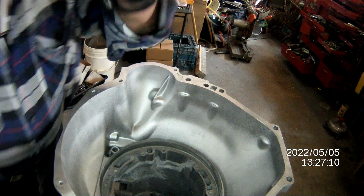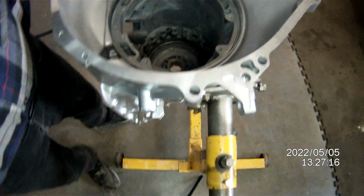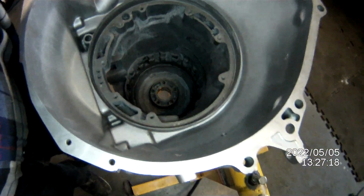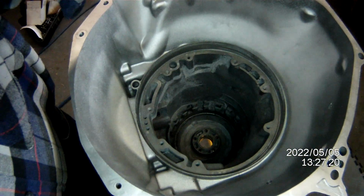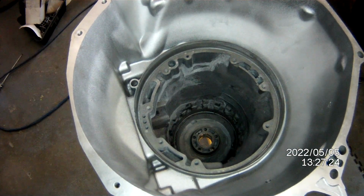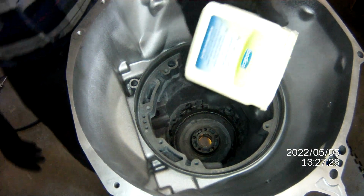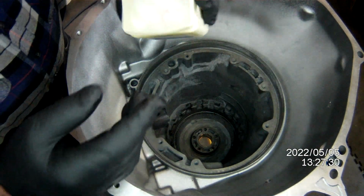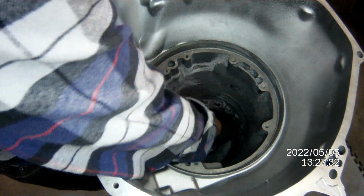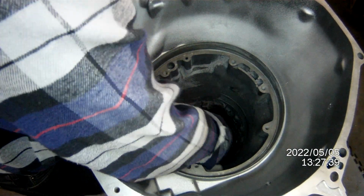First thing you gotta do, you gotta lube where the rear piston's going. Here, we'll slide this down a little bit so you can see, hopefully. I like using good old petroleum jelly, Vaseline, whatever you want to call it. Lube where the seals are going to go in here. Lube them up nice. Center and outside.